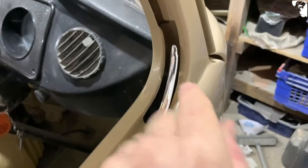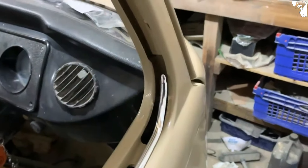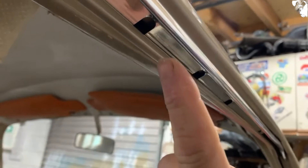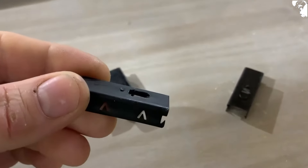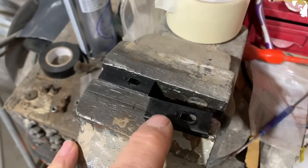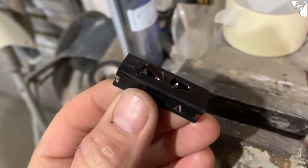I've got to drill the holes for the actual felt channel clip — they're non-existent. The size of these clips, I don't even know how I'm going to get them in there. The problems on this side with the trim are that the clips are very hard — near on impossible — to get in. If I gave them a tap they'd ping out, to be honest. There's a small tab at the end that's meant to curl round and keep the piece in place, but the tab's too short so it doesn't even curl round. And none of the holes up here for the felt channel clips line up at all. I've got to somehow Dremel out the hole for the felt channel clip.